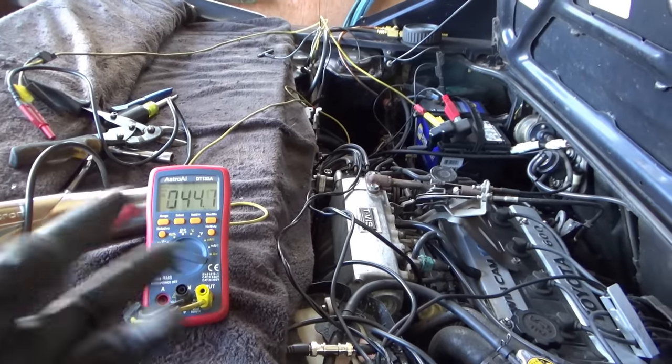Also, when the throttle is fully closed, that little contact closes and tells the computer we're at idle. On this system it also goes back to default mode where it doesn't look at the oxygen sensor, because it's a single wire sensor and they're only really effective when there's enough hot exhaust flow heating them up. At idle there is very little exhaust flow, especially on this little tiny four-cylinder. I think it drops the fuel trims to zero - and therefore that's what the customer is saying: it's running and then boom, and then you tap the throttle and it goes back to the fuel trim table and responds. So we're dealing with a lean condition.